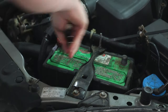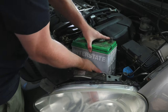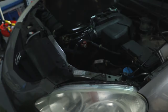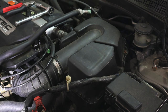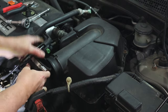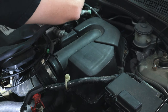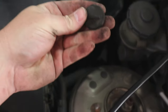There's our battery — by the way, I'm also replacing the battery while I'm in here. Go ahead and move the bottom of the battery tray as well. That was the clip for the vent hose. We're going to remove the sensor here as well — just unplug that.